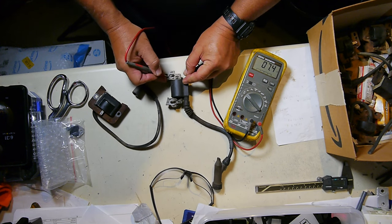Let's try another one. Primary at 1.5, and secondary at 6.21 kilo-ohms — this one would be in spec. That's basically it. Make sure you have the correct specifications for whatever magneto you're testing and see what range they're in. Sometimes the secondary resistance is a little higher — the higher the resistance, the less spark you'll have. Sometimes it'll just be a weak spark; other times, like when you read nothing at all, you'll get no spark whatsoever.